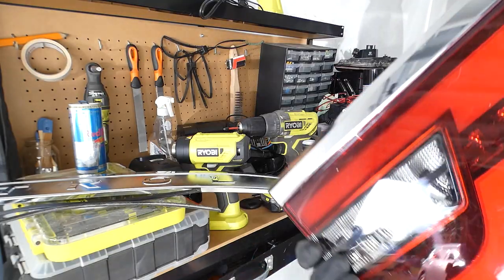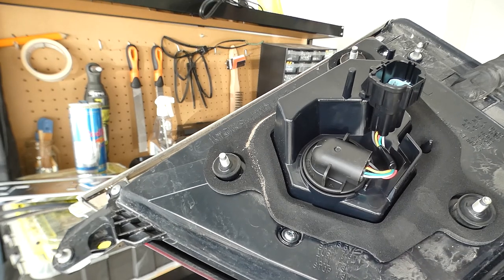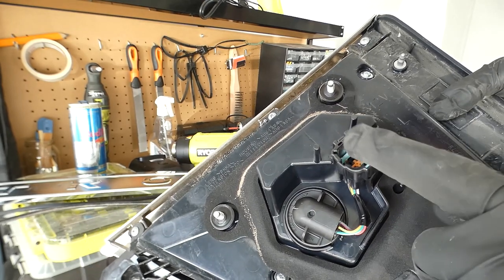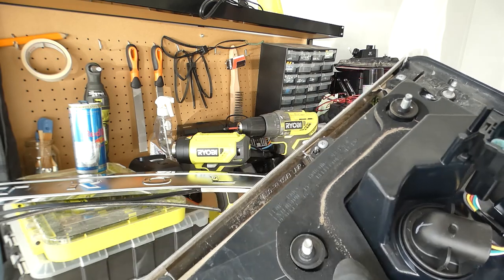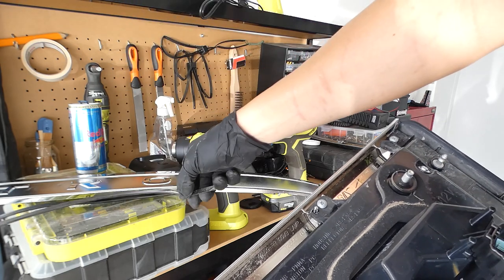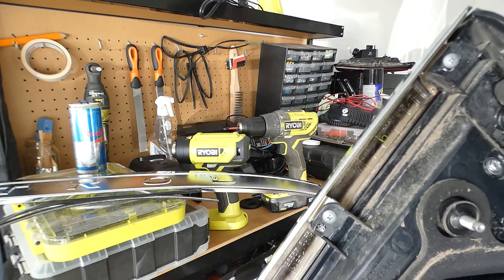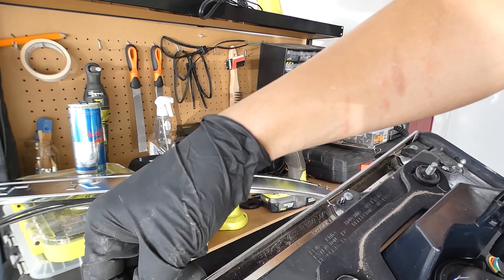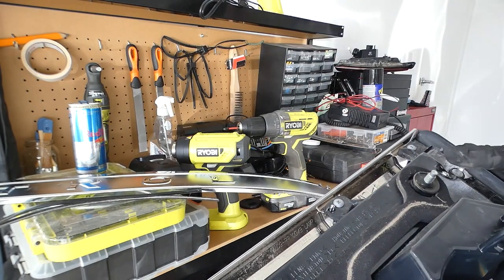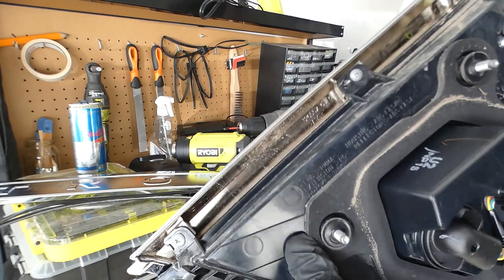When you're taking the intermediate lights out, all you've got to do is remove this plug — you don't have to worry about the other one. On the side tail lights you'll have to take them apart and do the clip on the inside, but with these ones you just remove this one plug because it makes it so much easier. Also, the top has a seal that runs along in here to help keep dust and water out — make sure you keep that and put it back in that slot. We might have to cut the wrap flush so that seal can fit back in.